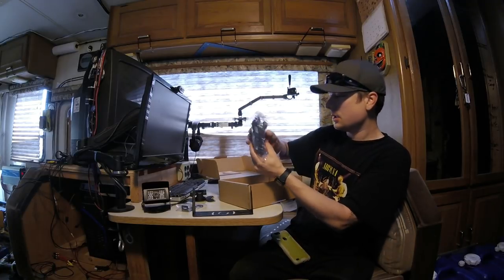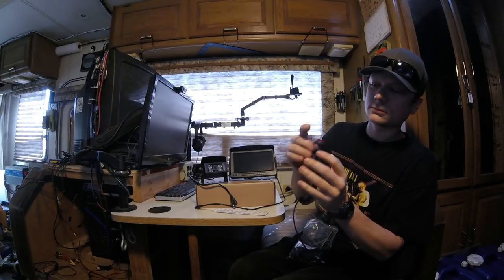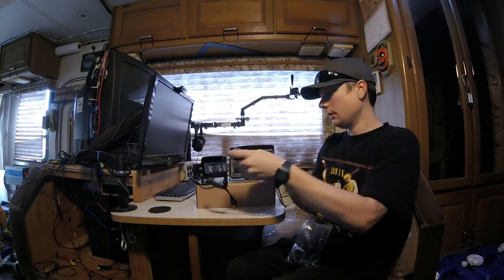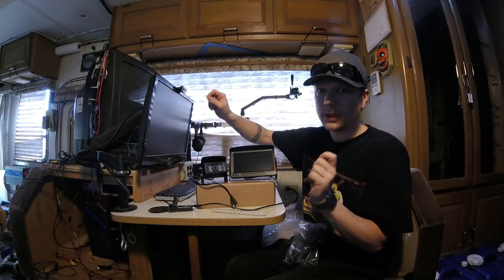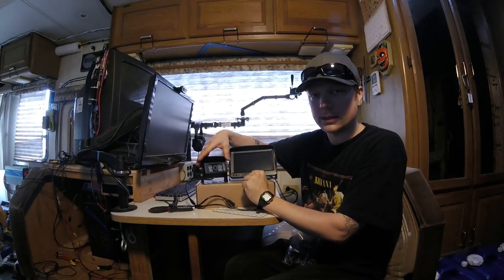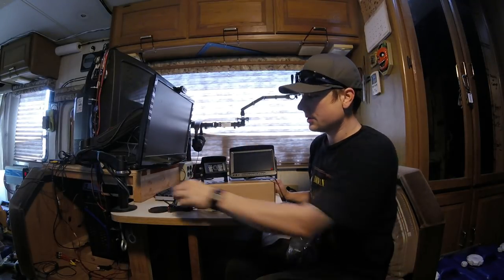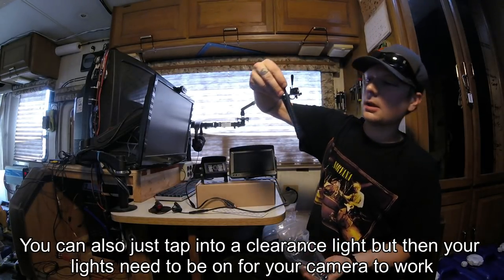There's a little package of goodies: a car adapter for the monitor, a push-on button that goes to the monitor, and that goes to your power outlet — easy install. The camera is going to take a bit more work to get power to it using a long piece of wire. I'll put a link below for 18 gauge wire, which I've been using for all my other CCTV camera stuff. You run it the length of your RV and attach it at the lighter socket, so whenever the ignition is on, the camera is on.